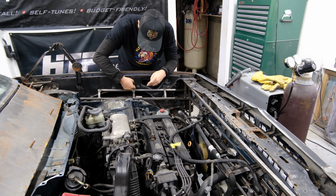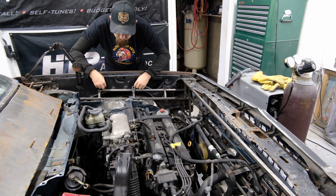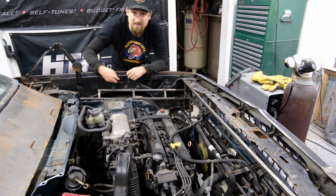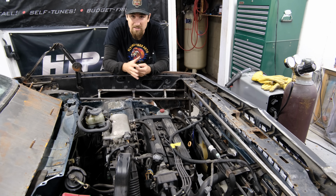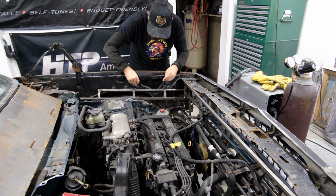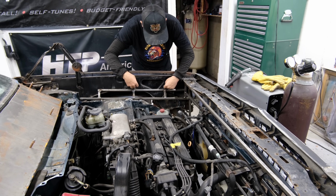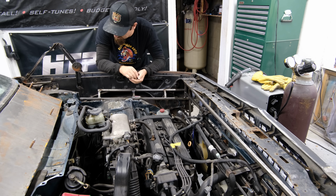I will have to hold that one up when I get there. And then another one somewhere over here. The reason I'm doing that is because we need to make the fenders detachable. They need to be stabilized. And also I need to make sure the way that I am installing them makes sense. If I hooked it down like this, then I'd have to install it in a weird way. That's why I'm opting for a completely vertical one, so that by the time all these tabs go on there, I can run a bolt through it in here. And in three spots, we are going to be good.